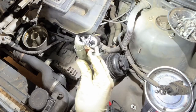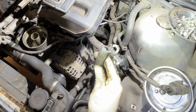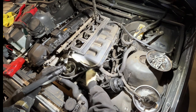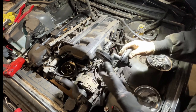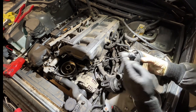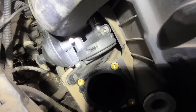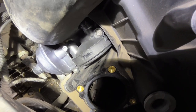There's our culprit, torn oil drain back hose. Definitely seen better days. There she is. So this hose is the culprit. This one goes to the valve cover. This one goes into the intake stream. All right, so that breather's reinstalled in there. Now we're gonna start getting the hoses connected back up and getting the housing settled back down.